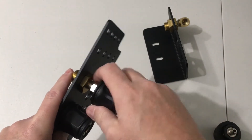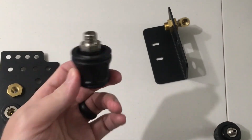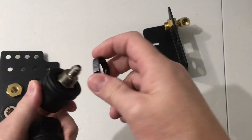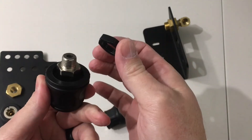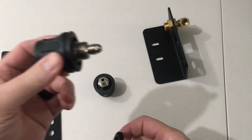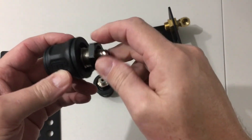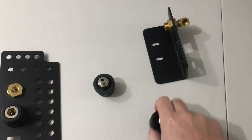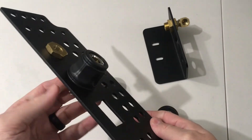I've had a lot of people shoot me an email saying they can't get this thing to thread on the plate. Well, that's why — because you cannot thread this nut on here. This only works for the JIC fitting, the JIC-4 ARB air coupler fitting. These will let you thread this directly onto several of the different plates — the air chuck holders and other pieces we have available.